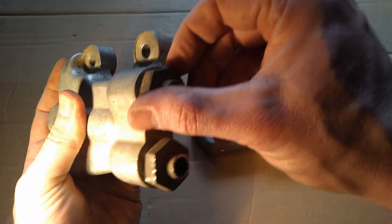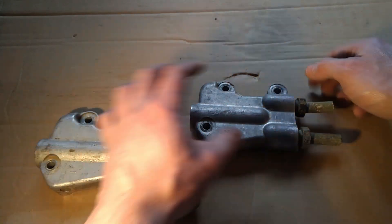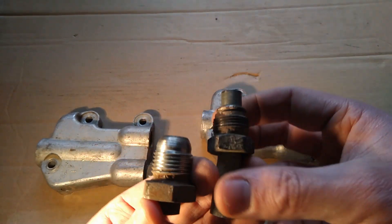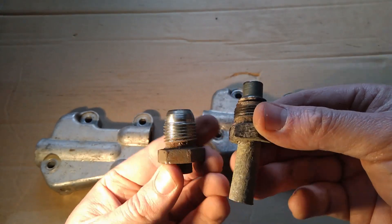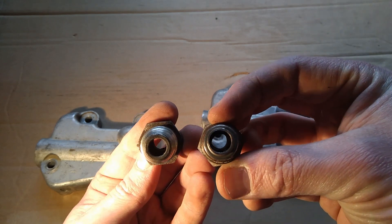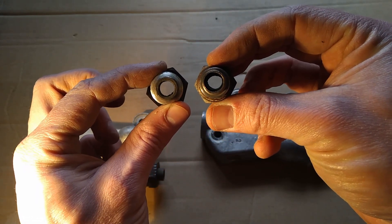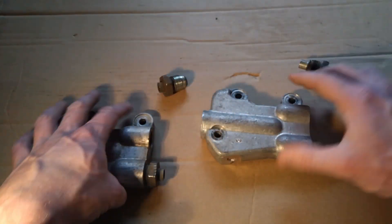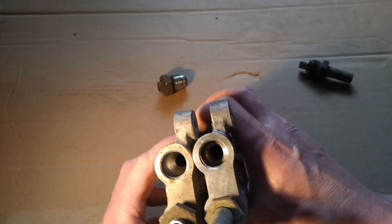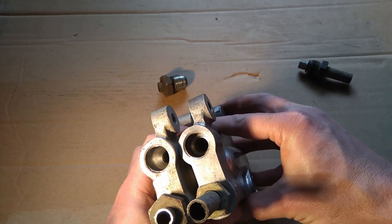I'm going to unscrew these and show you why right now. I've kept these — these are from some old rubbishy pipes — just so that at a later date I can measure them up and give you some dimensions. So on the right we have the R380 version and on the left we have the LT77, which uses a conical tapered fitting, and on the right we've got a crush fitting that has an O-ring — there's supposed to be an O-ring on there. Diameter-wise they're about the same, just the right-hand pipe had a bit of a kink in it. But you can see in the adapters themselves the different fittings, how they fit in and how they seal up against the end of the pipes.